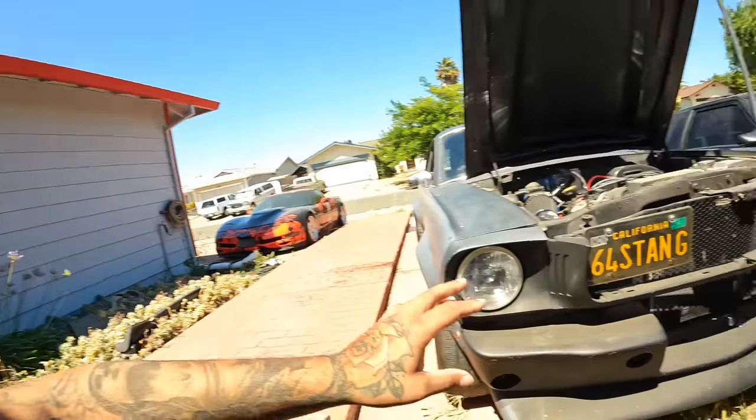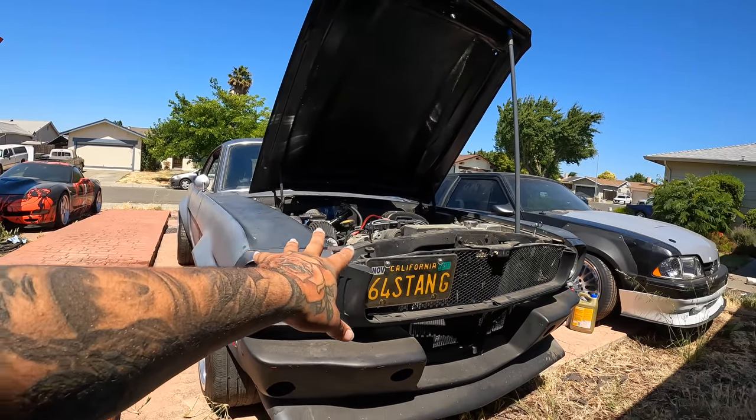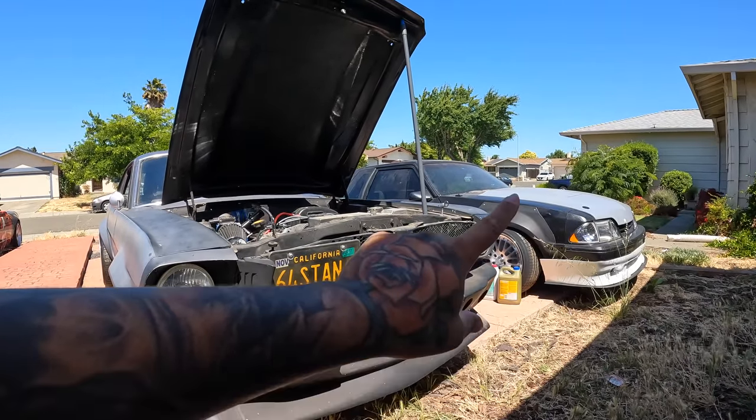Because then I can use all my old accessories. Like from here, I can pull the supercharger off of the swing thing, throw it on this thing with a 302 R block. The 302 R block is pretty much the small equivalent, I guess you could say, of a 351 or whatever. It has the four bolt mains, so it's strong. They do 1,000 horsepower on that block.